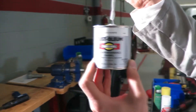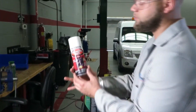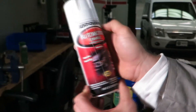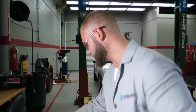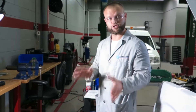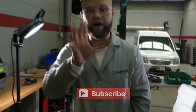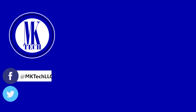This is the rust-proof paint I use — Rust-Oleum — and I customize the brush a bit with a small grommet. I'll also use this paint to touch up things underneath as needed. Anything you drill, you need to touch up with paint. Even if someone says it's an aluminum body, it doesn't matter — if you drill it, you touch it up. So I'm going to get all the measurements in the back, drill them, and after that we'll proceed to the next step.